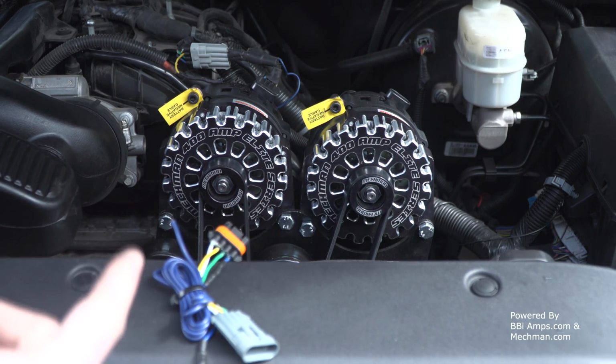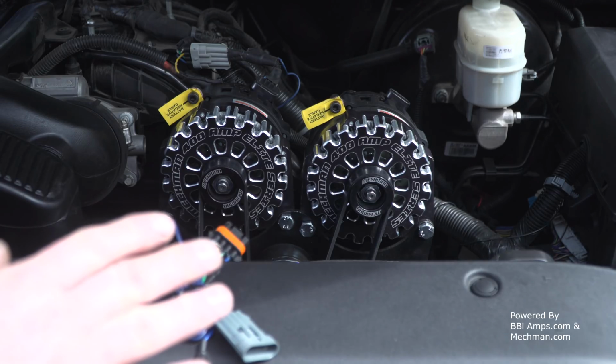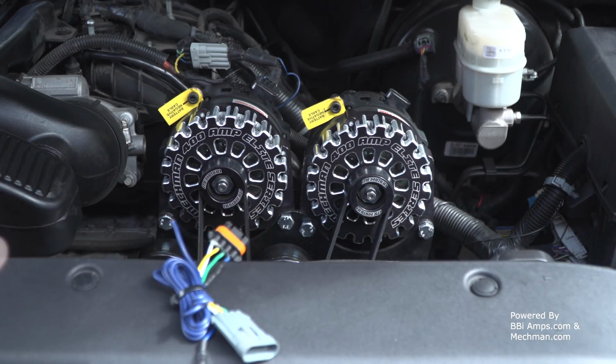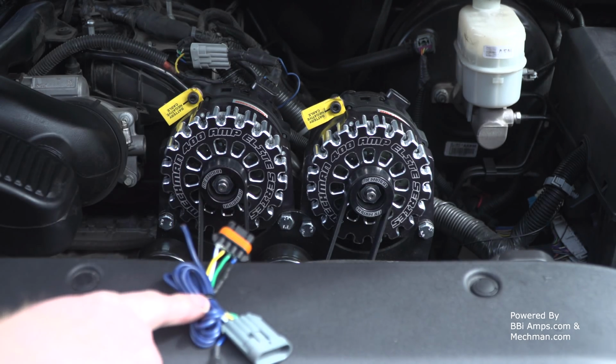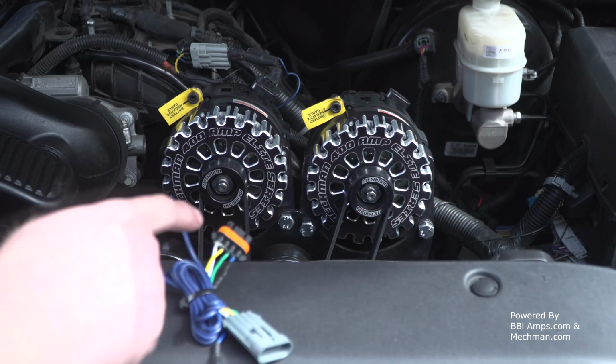So it's sending that 5-volt lead, and you cannot use that 5.3 volt lead as your trigger source. Just keep that in mind. Has to be a 12-volt solid signal. Comes in on the blue line. Okay? So brown goes to white, and your white wire goes to green.